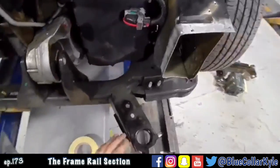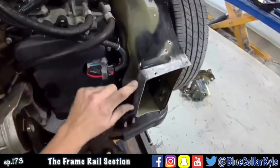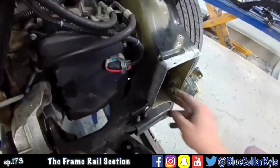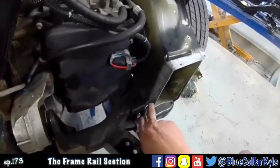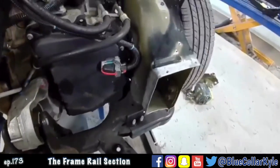So the reason they have me cut this a 1/4 inch long from the line is I'm actually going to slot the corners in like a V shape, and I fold this in slightly, and that creates a backer. So my new piece will sit over top of it right to the line where it's supposed to be, and that acts as the backer.